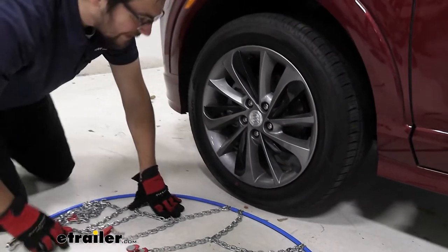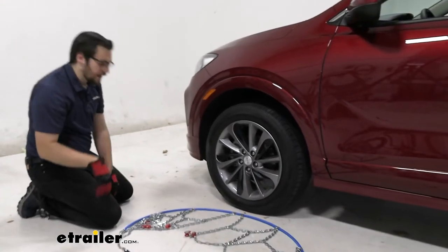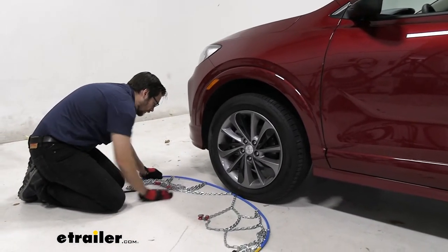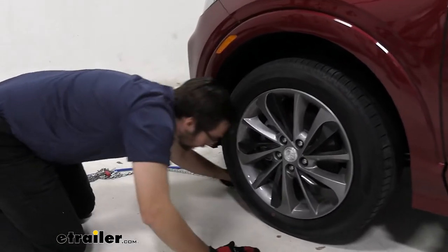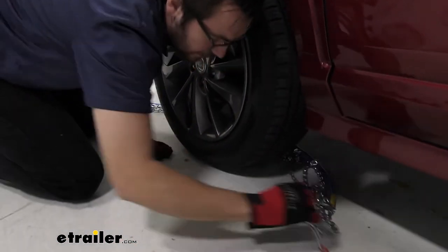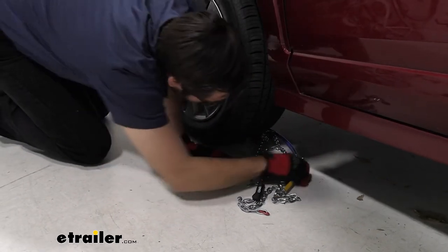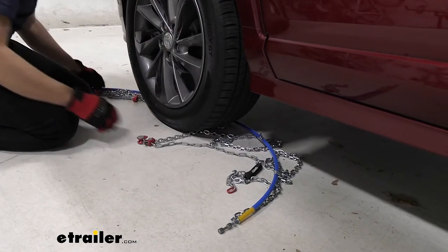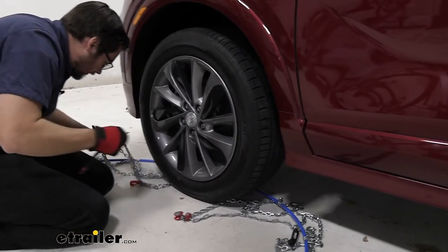What we're doing here is simply sliding this around our wheel and enveloping our tire, so we want that soft point actually making contact. Once that's looking good, we just go ahead and group these guys like so. I like to get them close to the plastic — that makes it just a little bit easier to swing around your tire, especially if you're in snow and ice. It's going to be easier to grip it all so you're not dragging the whole chain with you. I like to get this pulley on the other side, which makes it easier to have your first connection, and same with your tensioner on the other side.